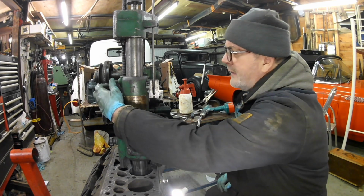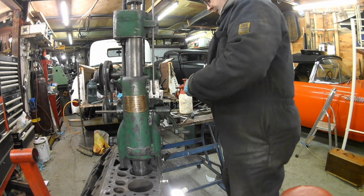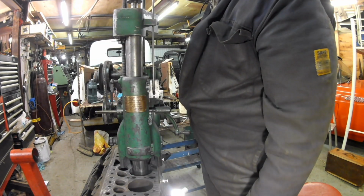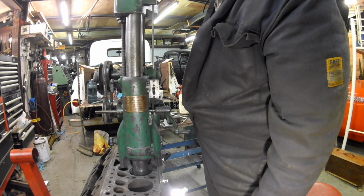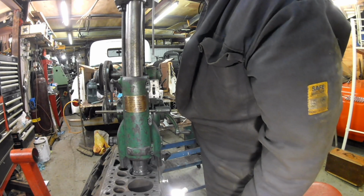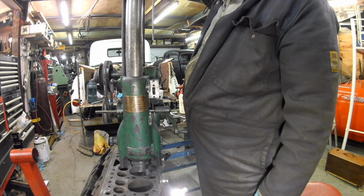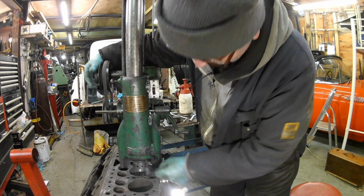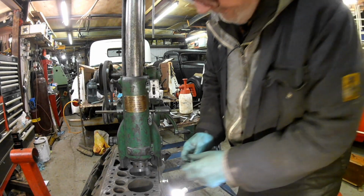Okay, we're getting towards where we need to evaluate our plans now. That's 3.370. So one more 30 thou cut at 3 point, we'll bring it to 3.400. And then on the last 2 cuts I'll change the tool and put a new tip in.